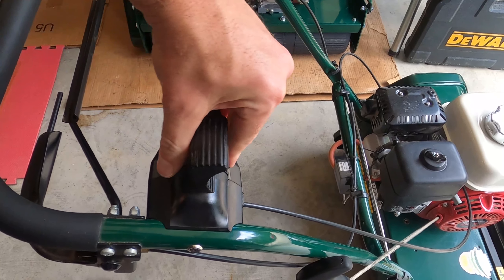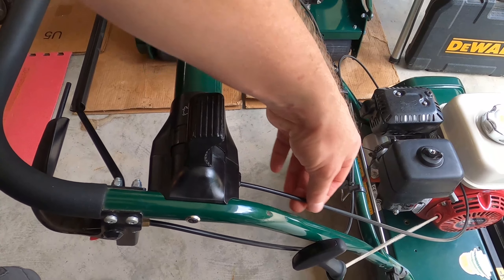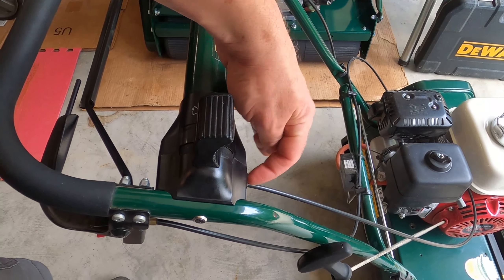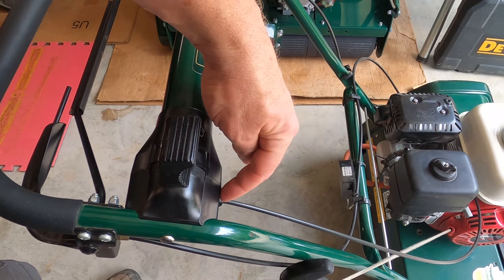Let's see how smooth it is now. If you ever run into any resistance here, make sure you take this apart and look at it. Chances are that little washer inside the housing may be bent — it's a really quick and easy fix.